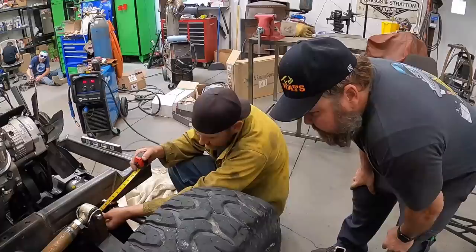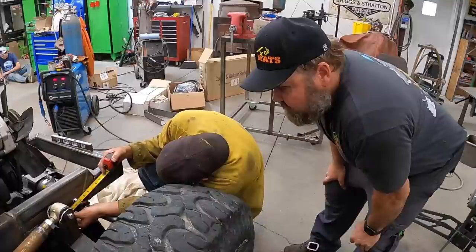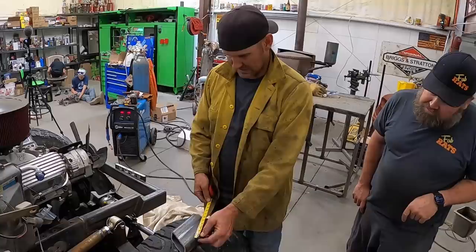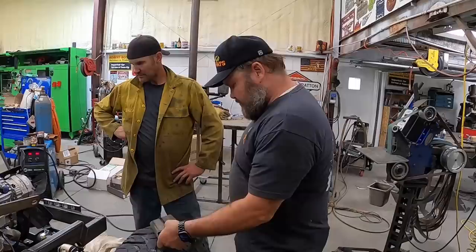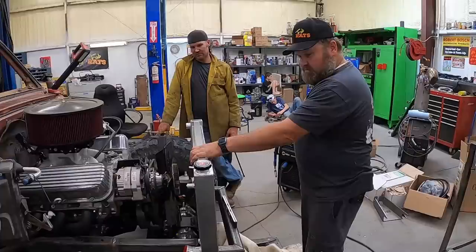Yeah, 5 inch is plenty, but how to cut that angle, plasma cutter. Get your micrometer out. If you just cut it off square, and then you start at 2 inches here, and go to nothing up there basically, and just weld that piece in it. That's what we'll do. And then that'll work as our hard bump on the front end, be able to winch it down. I know that our pulleys won't ever hit. Radiators should be fine, right? Yeah. It's gonna work. Little by little, we're gaining.